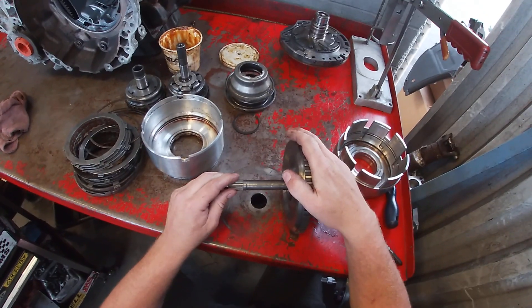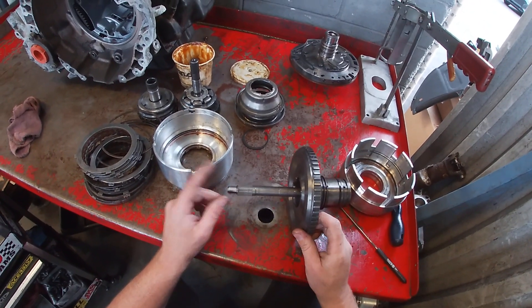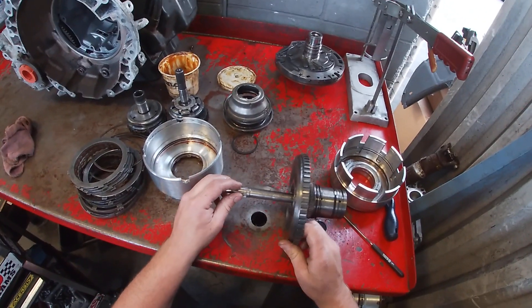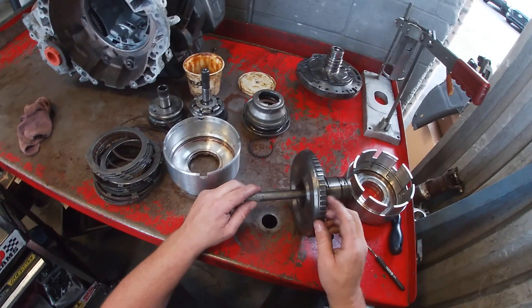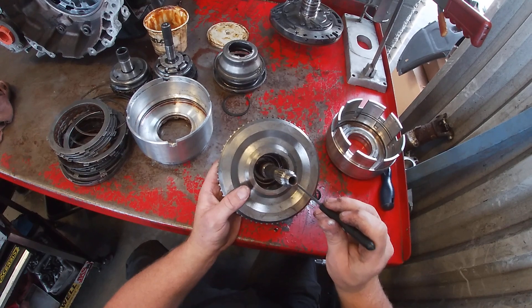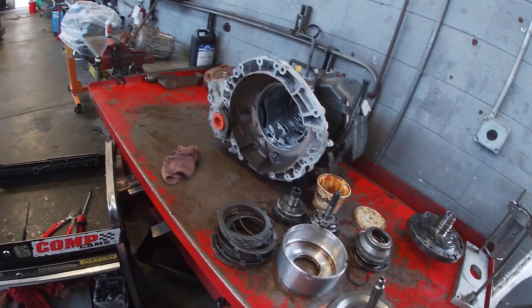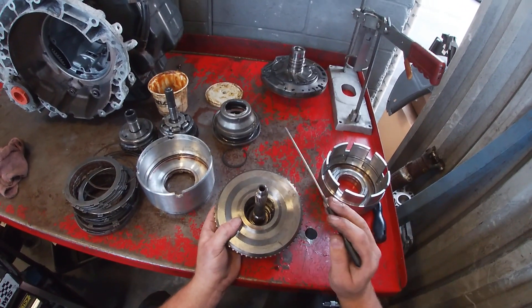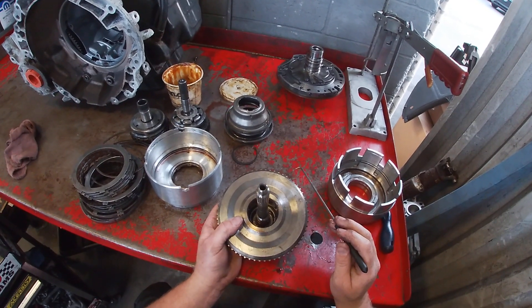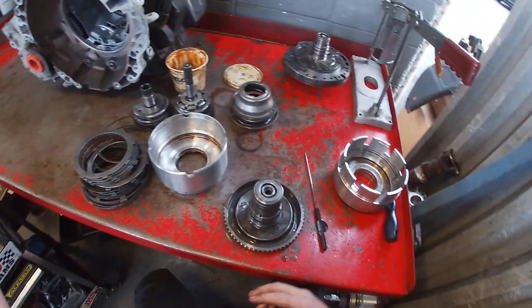That's different between different transmissions — for example, Chrysler's RFE series in rear-wheel-drive trucks and SUVs do have some play, so you need experience to feel the difference. It's good to have a known-good transmission to compare against, since a core unit like this might show incorrect things. The failed bushing in this assembly costs about ninety dollars on its own, but along with all the other parts needed to freshen up this transmission, the total exceeded the cost of a new unit, so it gets replaced. This is a core unit we're using for demonstration purposes only. We'll catch you in the next video — thank you all for watching.